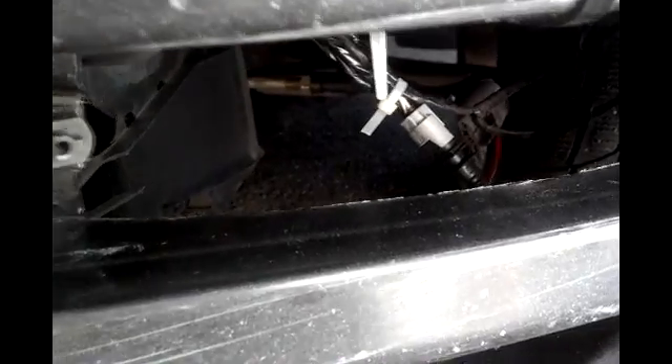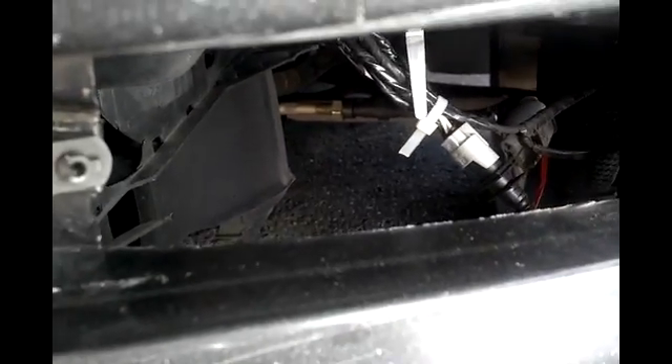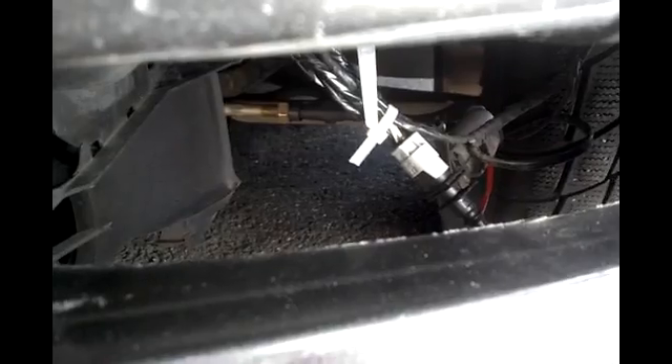Here's my final repair — just wrapped it up with some electrical tape to protect it. I'm going to tape it up into this existing harness, which should be far enough away and high enough not to contact anything, and throw a zip tie on there. There's my sensor with a zip tie in my wiring harness — this is going to allow my compressor to now activate. Now you can do a repair and replace and rewire this outside temperature sensor on your BMW. This used to be a common thing I used to see — but a very simple repair, something you can definitely do yourself. Thanks for watching, I hope this video was helpful.